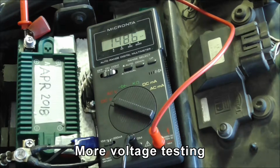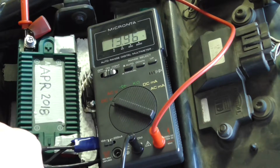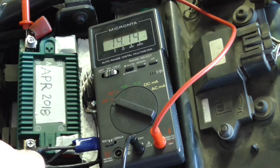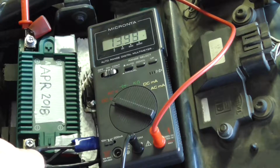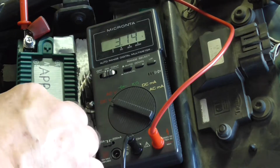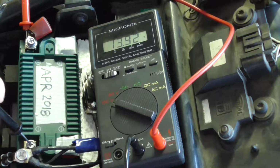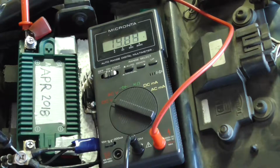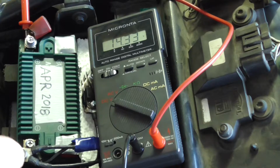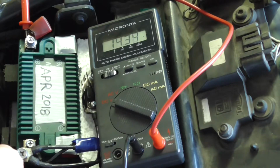Okay, so it's interesting with the diode set in, the regulator, which was putting out 14.5 volts, is now putting out around 14. Oh, there it goes, 14.1. This is at idle too, so it's doing quite well. But when you rev it up, it drops a little. 13.95. The battery is here. About a 0.1 volt drop. 13.9. 13.06. And now I'm back at idle and the volts are actually getting higher. It does eventually cut off at 14.5.